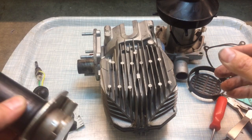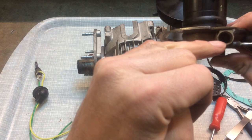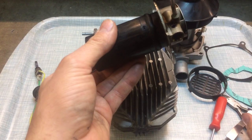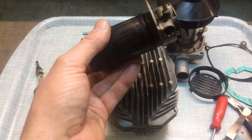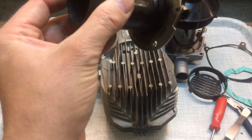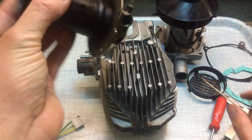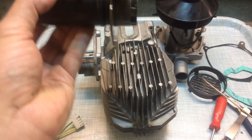What did take a while was the burner. This is our burner here, and inside there's a little gauze in there. Mine's intact, but if that's broken then it's essential to replace it. The way I've cleaned it is to pour some petrol in, let that sit for a while and run through, and then all of the black deposits escape from the end. I've also used a Q-tip to clean inside right down the bottom. It's really important you get rid of all of the deposits in there, because if you've got anything remaining it's not going to burn cleanly and you'll end up back to square one.